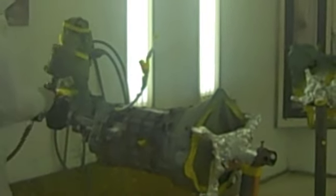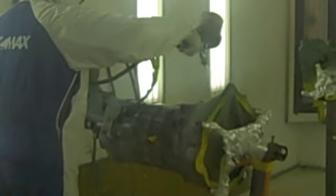Whatever impurities are on the metal right now are being covered up with this etch prime. After this, we let it sit for about five minutes and we'll spray the sealer on top. After the sealer sets up and dries, we'll put the base coat down, which is the color. The color will set up for ten minutes and then we will put the clear coat on top of that.